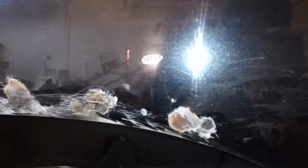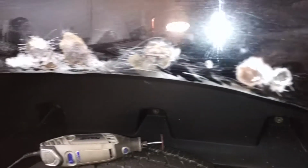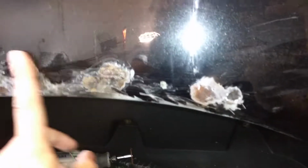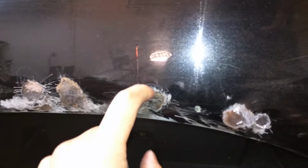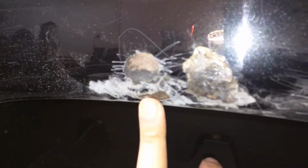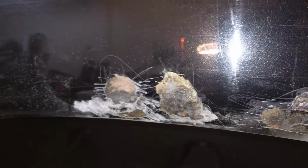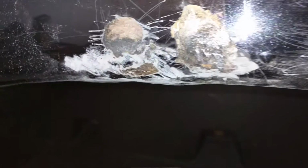But as you can see, the corrosion is pretty invasive in these spots. What I did was I just took a screwdriver, and you can do that, and I just peeled away the bad stuff, the really bad stuff, the bubbled paint, to get to what was underneath it. Because I haven't taken a Dremel to this stuff yet, you can see how bad it actually is under there, especially if I focus it a little more. There we go. That's a better focus. And as you can see, it's not through the metal. However, it's dangerously close in some points.